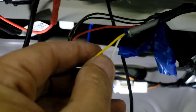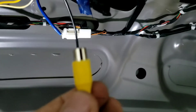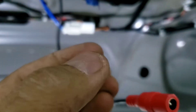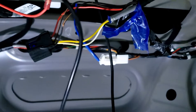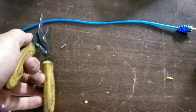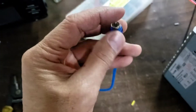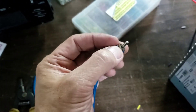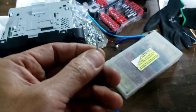I'm going to tap the yellow to the positive. As you can see right here, this is a video input — I'm going to plug the positive, which is the male end, to the yellow, and then the white to the negative. You're going to have to cut one of the RCA jacks about eight inches and cut it right there. Once you cut it, strip it. On this cable, the gray wire is positive and the other one is negative.